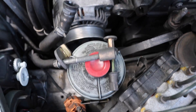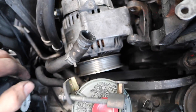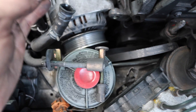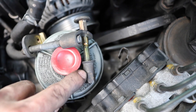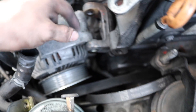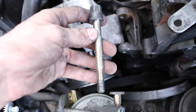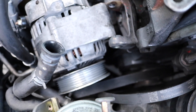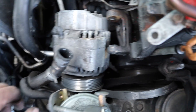This is that 10mm that was all the way in the front of the alternator, somewhere over here. Pretty much this piece goes to the side like that, hugging the side of the alternator. This is the piece that's on the bottom — that 12mm on the bottom of the pulley. So I took off the nut; here's the bolt that was inside of the alternator on the bottom, and then this is the top one that I just took out. That's the last one that should be holding the alternator, which is this bolt. Once you take off the bottom 12mm and then take out this one, it should be free — 100%, ready to go.